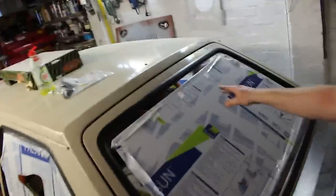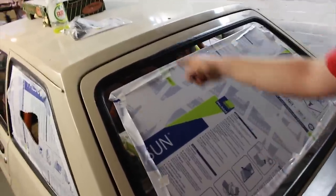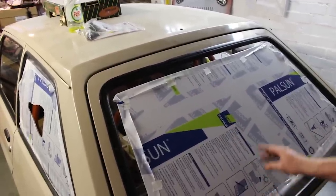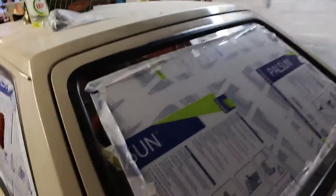The thing I forgot about when I last had a polycarbonate screen is how much flex is in it. I was always thinking of doing some kind of aluminium angle strips — maybe with a load of holes — that I can screw onto the inside of the boot and pick up on the window at certain points, just to give it a bit more bracing. I had one in before and it never popped out, but the nightmare scenario is you've got the windows open, you're ripping along the motorway, and it just flops out and hits the person behind you. So I'm probably going to put a couple of little straps down it to give it a little more support. Side windows aren't too bad because they're a lot smaller, but the back screen has got a lot of flex.